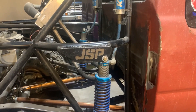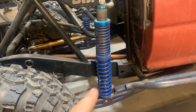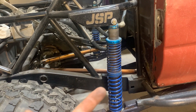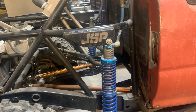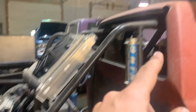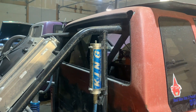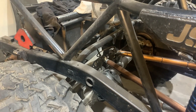What I'm most proud of is the back half. I did a single triangulated four-link in the rear with trailing arms. These are 14-inch, 2.5 King coilovers — no bypasses or anything like that; that costs a lot of money. I got these Kings for sale off Facebook Marketplace and got a good deal on those. The back half kind of ties into the cage at the back. All of the links and stuff I designed and welded myself. Full floater FJ80 rear axle, so a 9.5-inch diff there as well.